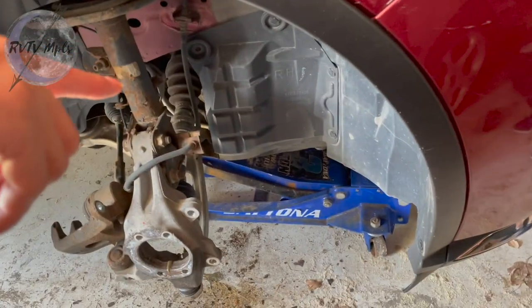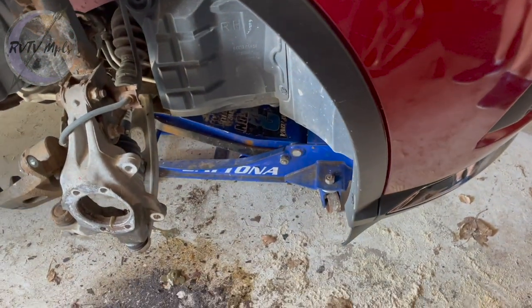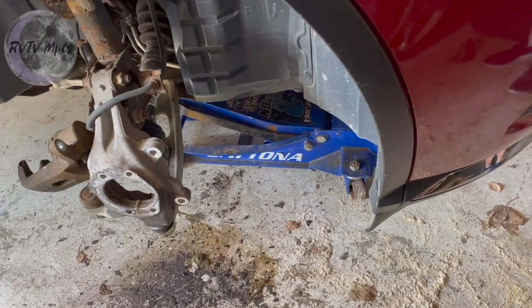I have a jack on the control arm that's got wheels on it. Okay. I got it lowered so we're pretty much even keel. I'm going to put the car in neutral, and I'm going to pull from this jack so I make sure that we're not slipping, and I'm going to have you push from the back.